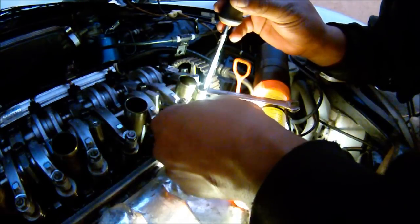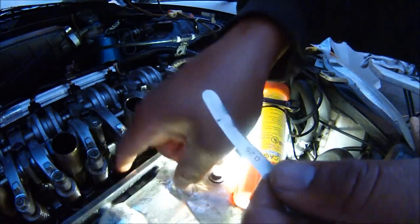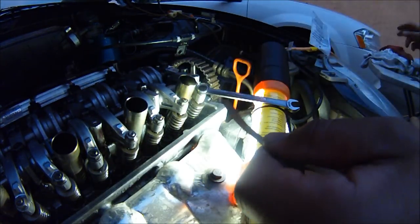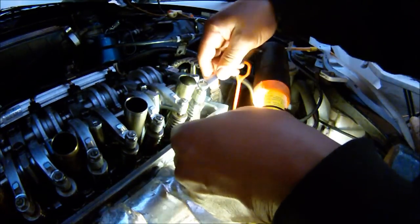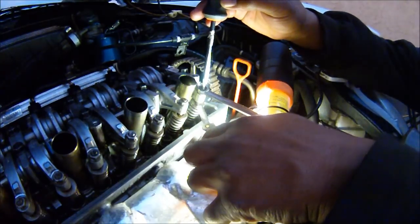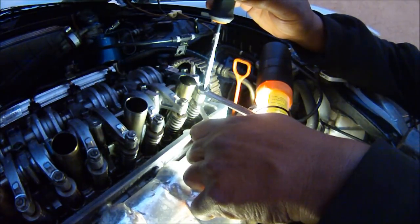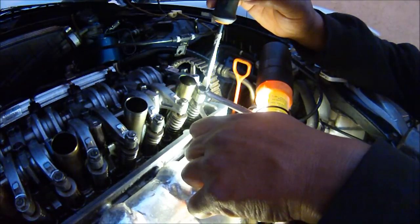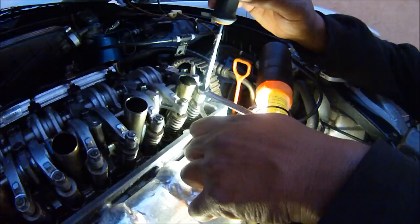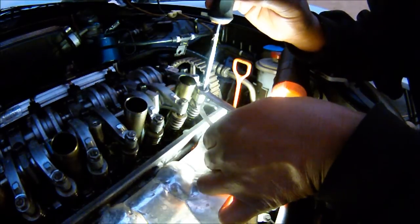Now what you're doing is you're feeling for snugness — you want it to be snug. Put some oil on your fingers and you want it to feel like that. Get that inside the gap — you're going to get it in like that, and slowly back off so you can move it. See as I turn the screwdriver — back off, and slowly keep moving it as you're tightening the tap at the end of the rocker. Now I can feel it starting to get snug, starting to tighten up. Right as it gets about smooth right there — that's good right there.